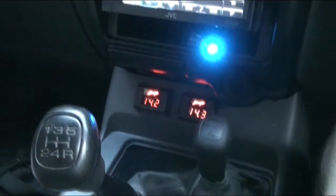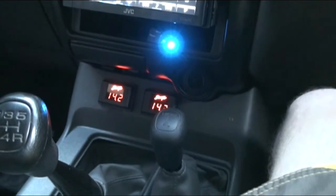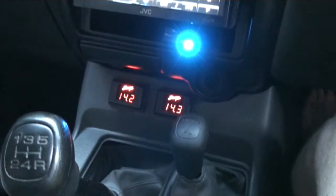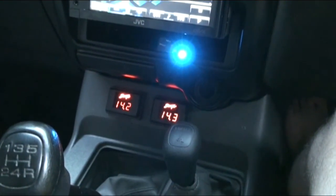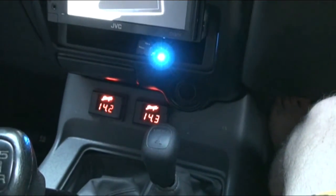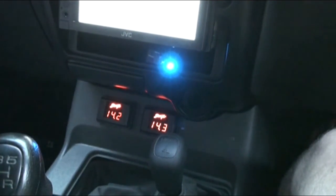So as I said, I'll probably be replacing batteries soon. Currently got three Optima D34s at 55 amp hours, and the front battery — I'll be kind and say it's 50 amp hours. It is pretty big but it's just stock. So probably 200 amp hours, maybe just above. I'm looking at getting three Full-River HC100s or HC105s — that's how many amp hours they are — so we'll have about another half of what I've got now. Plus all the batteries will be the same: decent batteries rather than three good ones and a poor one.